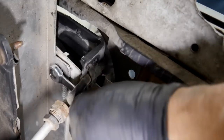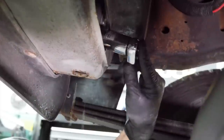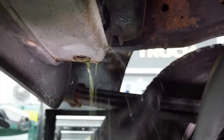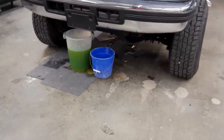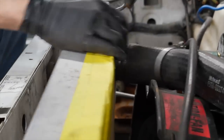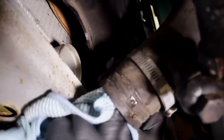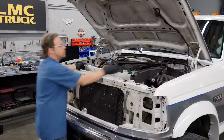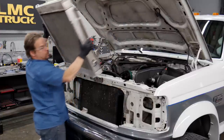The radiator is held in place with four bolts into the radiator support brackets, and the fan shroud is the same way. Once the fan shroud is unbolted and set back, we can drain the radiator and remove it. This truck is high enough off the ground where we can use buckets to collect the antifreeze — it's a couple of gallons of capacity. Some absorbing mats might help contain the mess that is inevitably going to happen draining a radiator. Once the upper and lower radiator hoses are removed, the radiator can be lifted out. Stuffing a rag in the lower hose is a nice trick to keep the antifreeze from dripping out. Ours is an aftermarket aluminum radiator which makes it nice and light. Keep in mind, new radiators, shrouds, and even electric fan kits are available from LMC Truck.